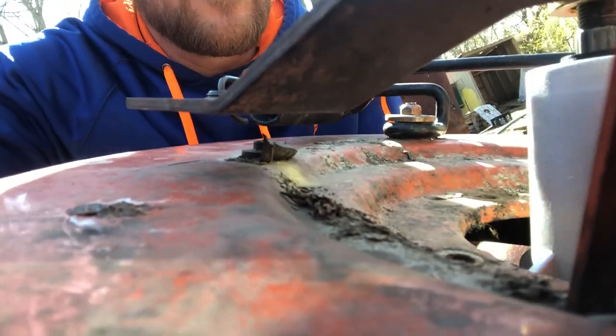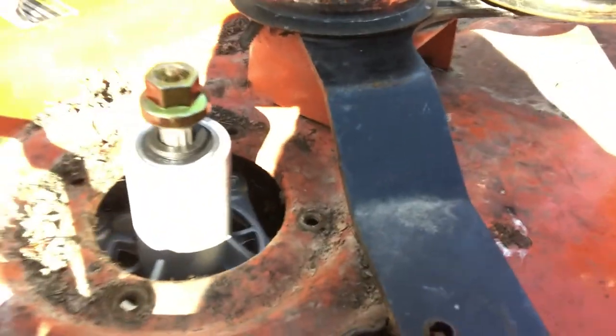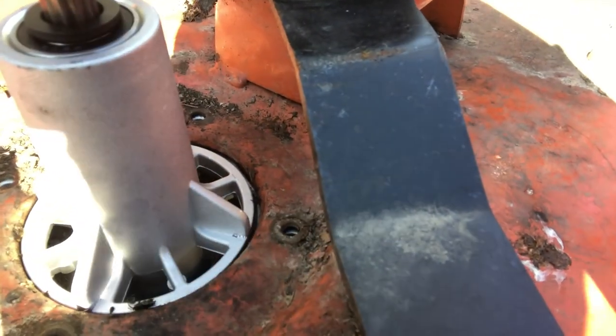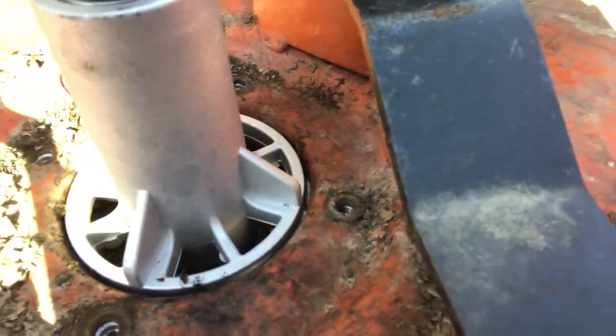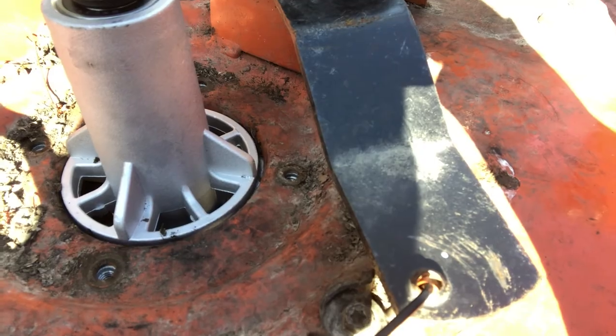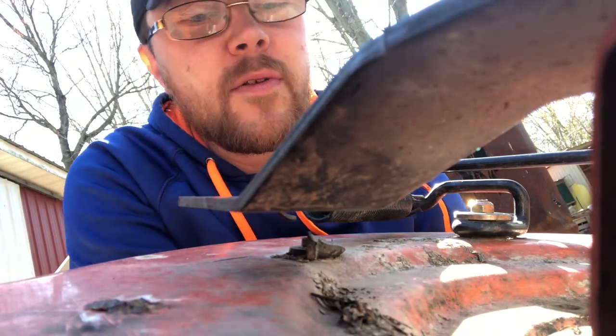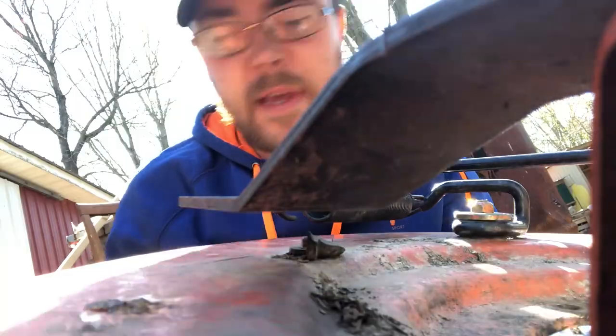And then, as you can see how it's coming up through here, you see the bolt holes. Make sure you get them lined up. Start threading them by hand as much as possible before you use the impact drill. That'll save you a lot of heartache in the long run. I promise you that. But anyway, you do that, which I left the bolt sitting over here, and I'm left-handed, so that was stupid. All right, so all of them are on there.